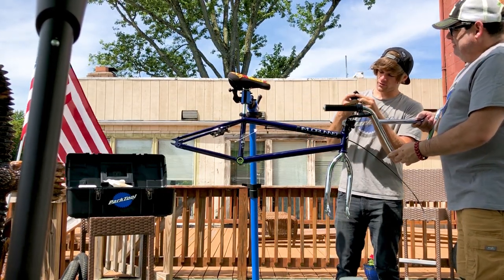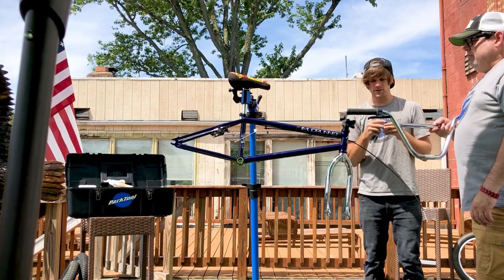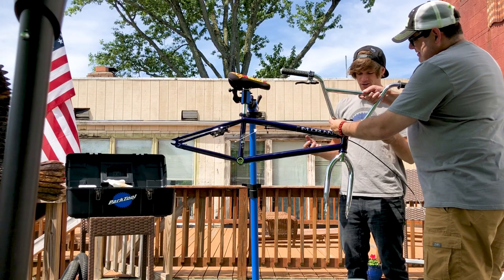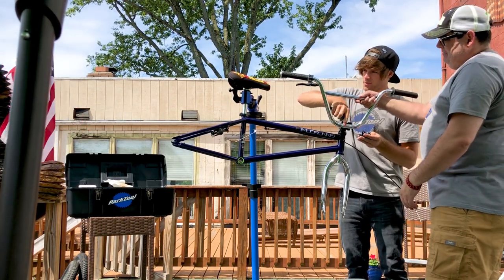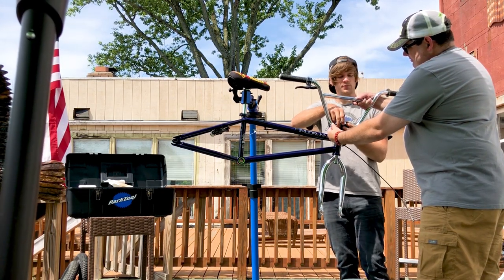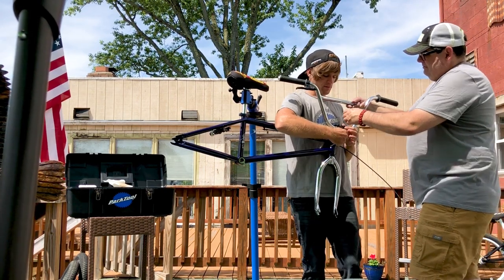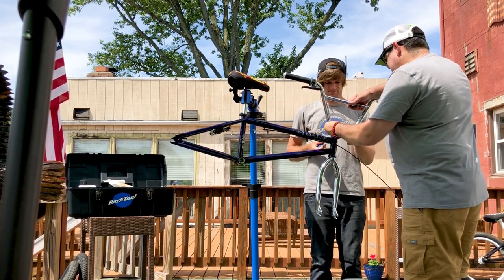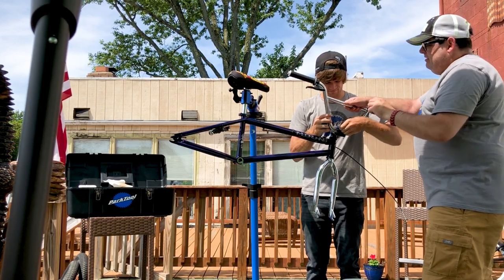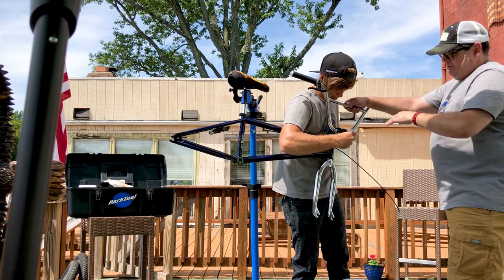What you want when you finally tighten your bars down: you want an equal gap either front and back or top and bottom between your front plate and your stem. You can see on your bikes between the cap and the stem there's that little gap — you want to always keep that gap the same on both sides. What that does is take pressure off evenly. If you do it lopsided, you're putting too much pressure on two of your bolts and not enough on the other two — they could break, or it could break your stem. If you do them all evenly and they're all carrying the same load, it's just that much stronger overall.